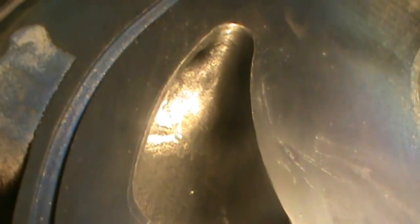I'll get working back on that secondary intake port I was working on - this was pretty much just a teaser for the next video. It's pretty much all finished off - it's down even with the bottom of the runner there. There's still a little ledge around the top, so I'm going to grind down that top ledge. I pretty much have to do the same thing - bring down that top wall even with the runners, then finish off the runners and start smoothing everything out.